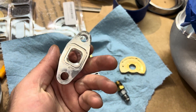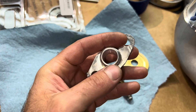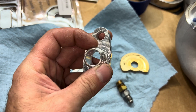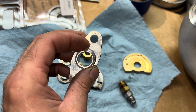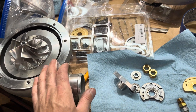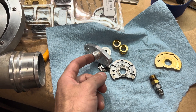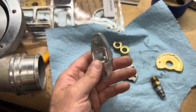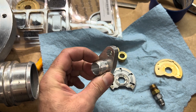This is the second problem that these have. When they send these to you, I'm guessing they sent this drain with it — either that or the guy had to buy one. These were made too small, so I machine them out to five-eighths inch, which is 0.625 inches. Before machining they're usually less than half an inch — about 12 millimeters, so roughly 450 thousandths. It's just not big enough for the drain necessary on these turbos. On a turbo this size coming off a factory vehicle, the drains are usually about 19 millimeters inside diameter. When I cut this out to five-eighths, that's not even close to 19 — it's more like 15 to 16 millimeters. I'm still undersized but this is big enough for it to work properly.